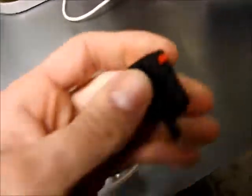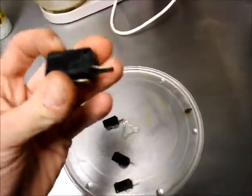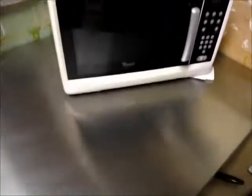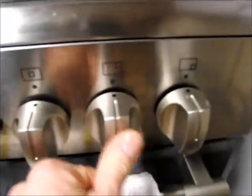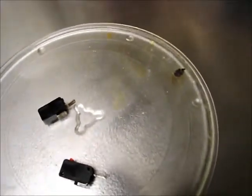In case you're wondering, so what? Well, just about everything in the home — a fair portion of electrical goods you take for granted — is going to have a microswitch in it. From this microwave oven here, there are door switches; you can hear them clicking away. There'll be a couple of different lockouts. This stove, when you push in the control knobs, has a microswitch on the gas valve. Washing machines have them as a lid switch — some use a reed switch, but microswitches tend to be a lot more reliable.